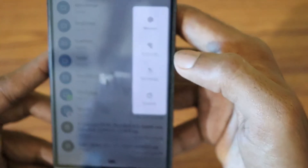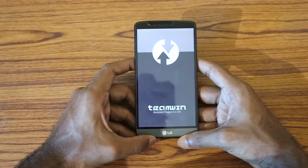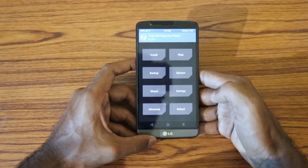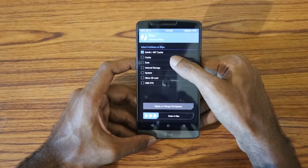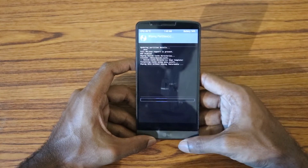Let me go to Advanced and then go to Recovery. Now we are inside TWRP recovery. First, I'd like you to do a backup so you don't lose your data. Click on Backup and swipe — it will back up your data. Then we'll do Advanced Wipe: check Dalvik cache, Data, and System, and swipe to erase.